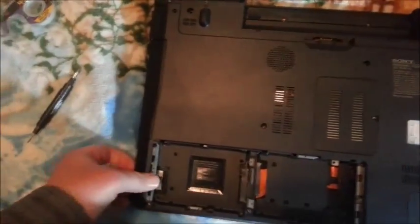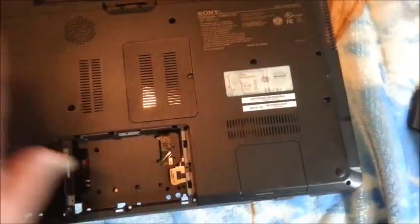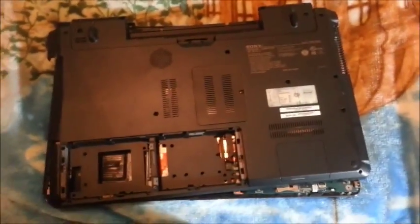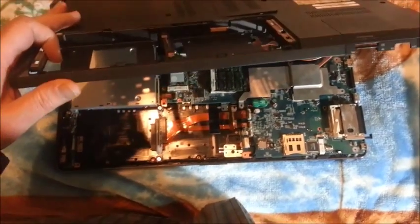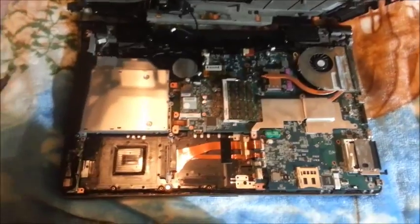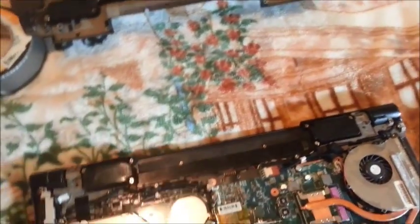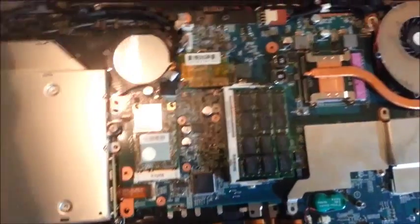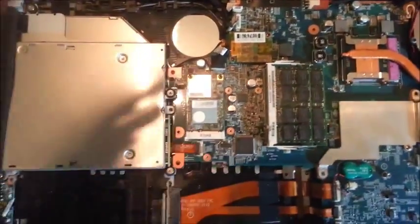It's all loose except for this corner over here. You want to push it in this direction to get it out, because if you just try to lift this corner up you're going to bust something and damage the connector — so be careful about that. There's a connector here that I think is for the subwoofer. That connector pops off very easily. All right, so you can set that aside. If you had removed the RAM cover door you'd be able to see the RAM and this little connector, so make sure when you put it back together that you remember to plug that in.